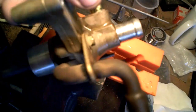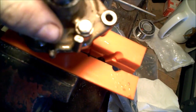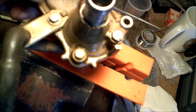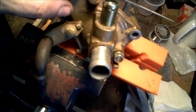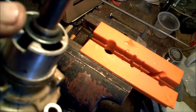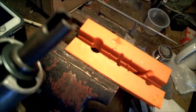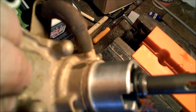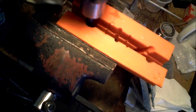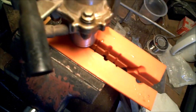We'll go ahead and unhook those two hoses, pull those two bolts, and see if we can jiggle that out of here. Here is the water pump assembly removed from the machine. That screw and that screw have seals on them — they look like they're in pretty good shape. I neglected to buy some, but if I were going to do it again I'd go ahead and replace those just because it's out. And there you can see where the hose attaches to the weep hole.